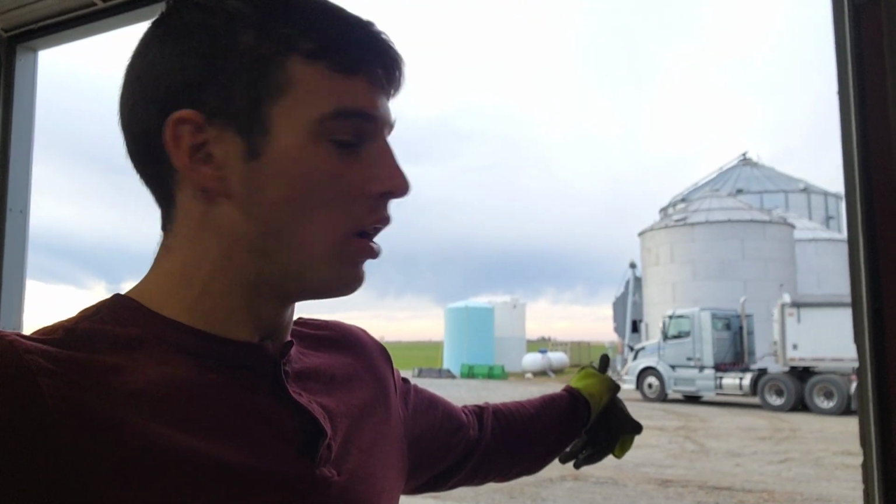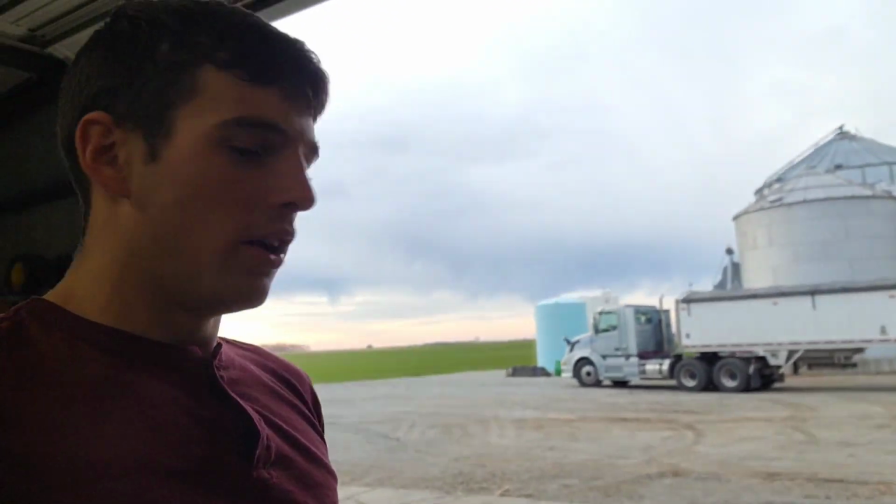Got that all done. I don't know if you noticed, Dad started that up, how fast it turned over. If you've watched previous videos you might have noticed that it used to turn over pretty slow. Also, in one of the previous videos, right at the beginning, we saw sparks shooting out of the bottom of the truck, right underneath the cab there. Dad looked into that a little bit, and I guess the ground post underneath there was all corroded. Some of the stuff was rusted together.